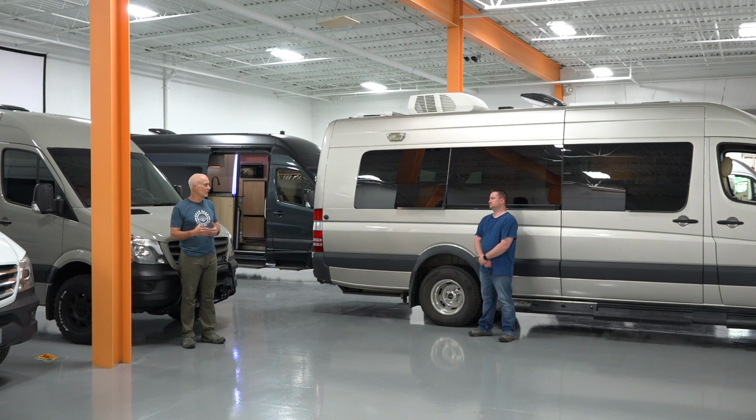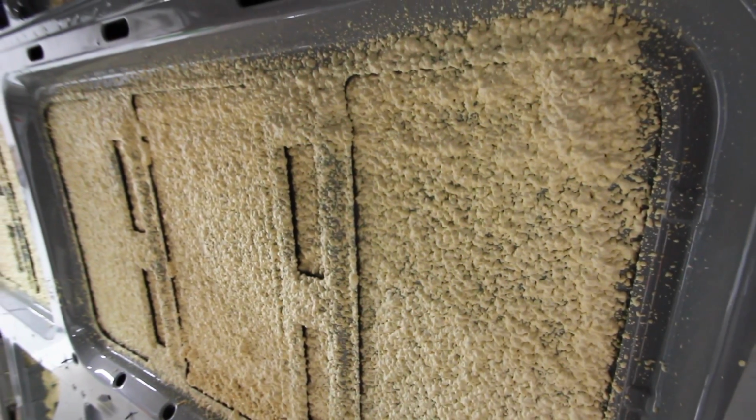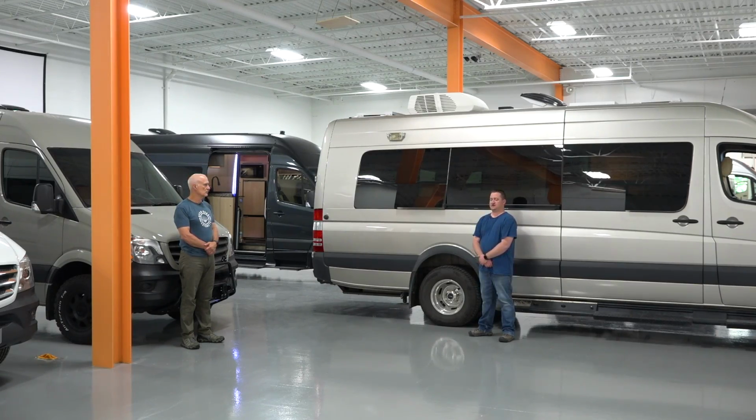We have had some experience with all three of those, so we'll talk a little bit about them. Mike, we've tried at least 3 times on 3 different vans polyurethane foam. We did, yeah. We tried it on 3 different vans and we peeled it off 3 different times. We tried a variety of different expansion rates because we thought heat was the issue. But ultimately what it came down to is that it caused the sheet metal to deform pretty extensively on the exterior of the van, very noticeably, to where we just decided it wasn't a good choice.